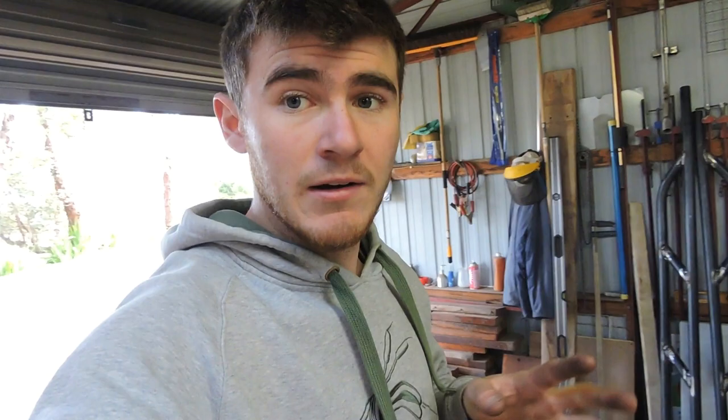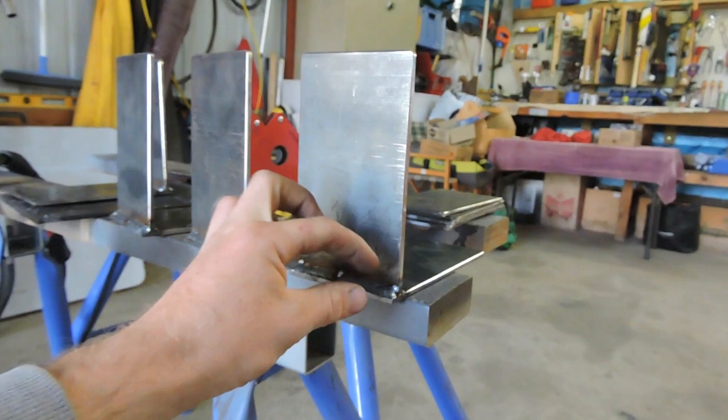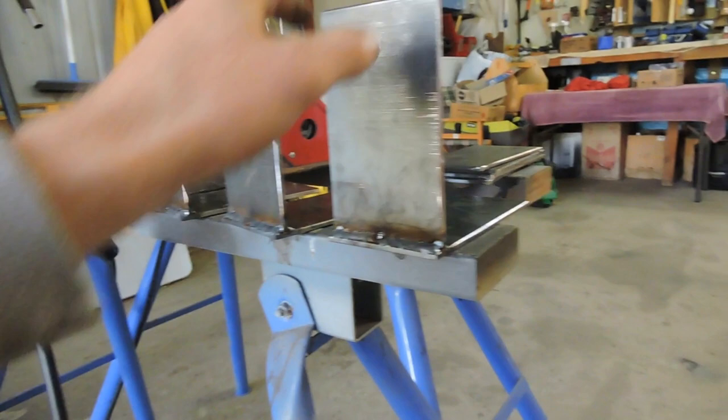I'm working on the brackets to connect the sliders to the chassis. I've got some 5 mil plate cut to 165 mil long by 100 mil wide - that happened to be the size of an off-cut from the metal shop and it was pretty much right. I've been under the car and got measurements. I'm going to use three brackets per slider but only have enough steel for two right now, so I'll get them on the car and get more later. I've welded up four L-shapes so far, leaving a lip on the bottom plate to get a really big thick weld and make it strong.